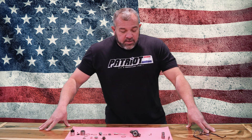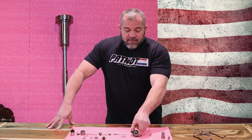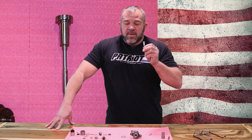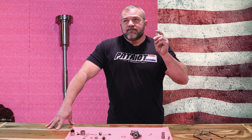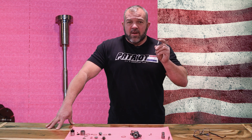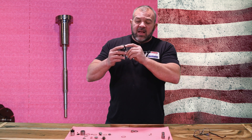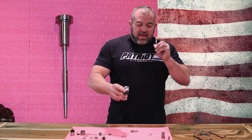So what are we going to replace? First off, the thing that's probably forgotten about and left alone the most is the control valve. You can't physically see this because it hides inside the body, but this thing is responsible for basically all of the fluid that ever flows through the injector.